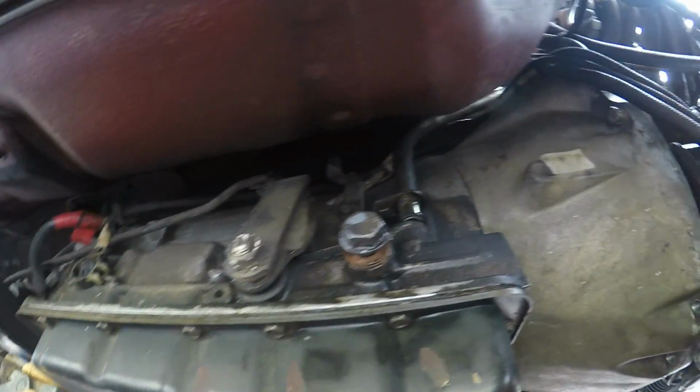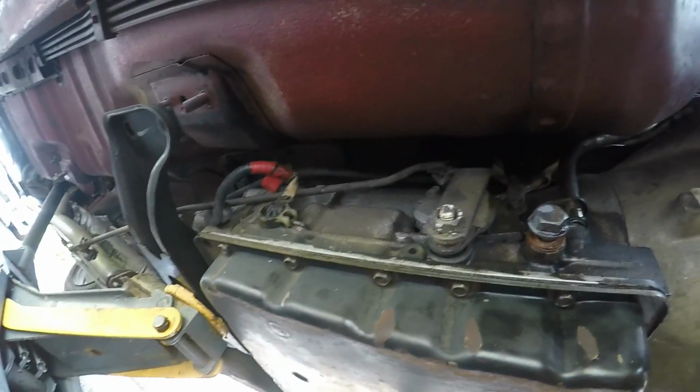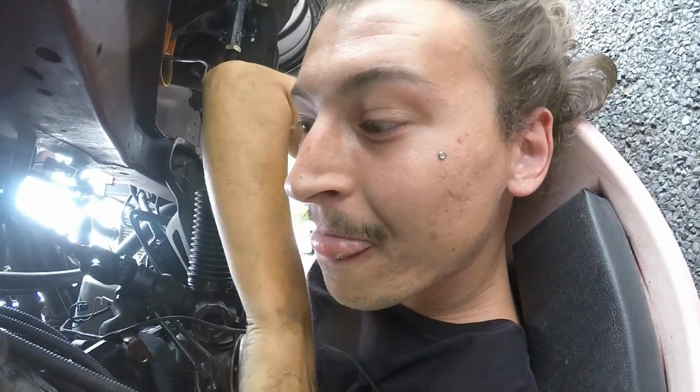So we've got the hardest bolt out. Literally everything's out. So we just undo one bolt either side, and the torque converter's still got 2 bolts in. So we unbolt the torque converter, unbolt these 2 bolts, and drop the box.